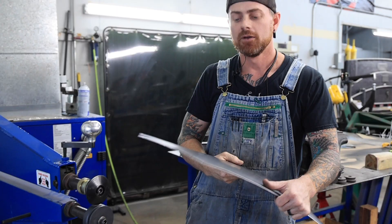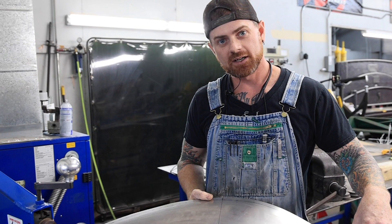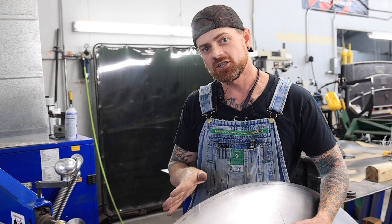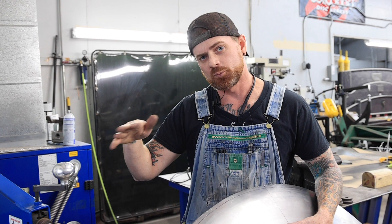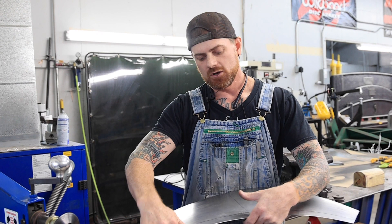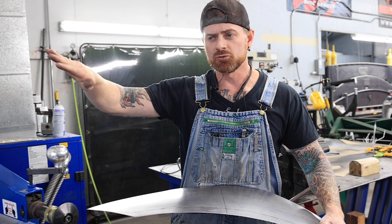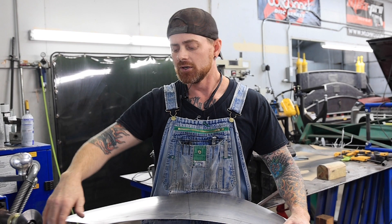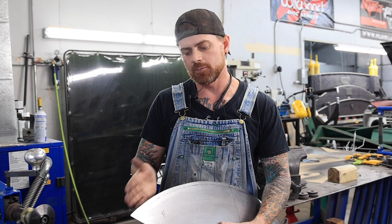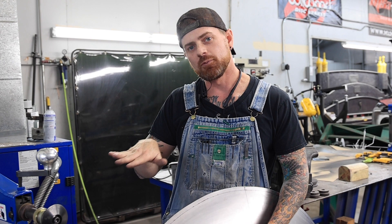Now that we've got our shape throughout at roughly a 25-inch radius, we're going to tip this edge. We'll run it through maybe two or three times, increasing pressure a little at a time. Then we'll take it to the car and set the angle, because a second gen Camaro fender rolls from the top and has a different gradual radius down the side. We'll get a general tip here — making that corner about a half inch — then use a hammer and dolly to tip it more or less to meet the fender so it laps over nicely and blends through.